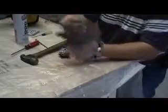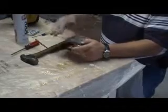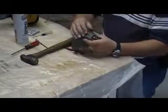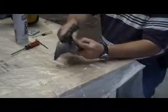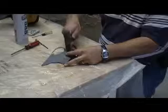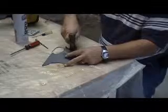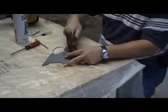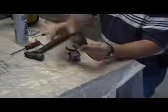So, what you have to do with this paper is put it over the place where you want to make the gasket. Make sure it's nice and clean, hold it into place, and you'll have to make an impression. Take a hammer or something, lay it on a table or whatever you've got, and you just start making an impression. I'm using a ball hammer because that little ball helps it get up into little crevices and things where I want my gasket to be.